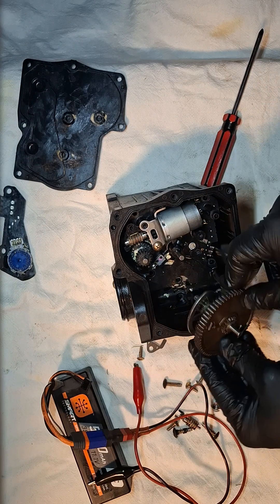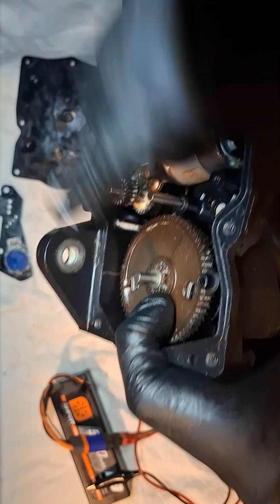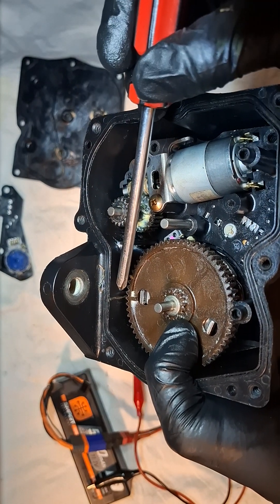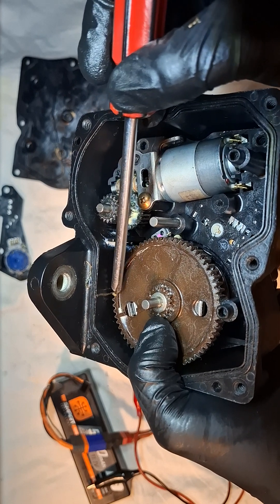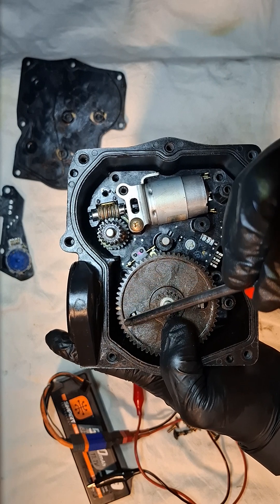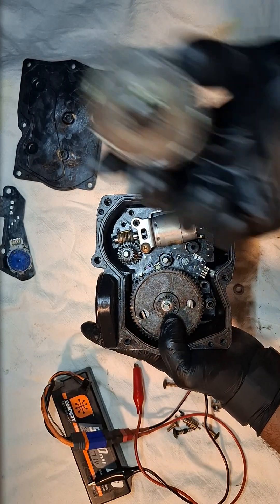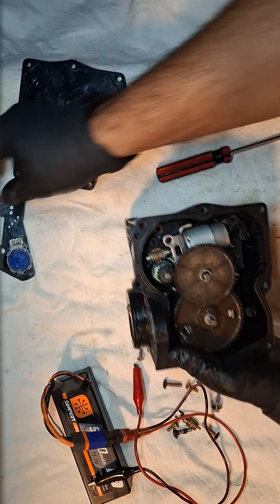What we are going to do is sit this one in the middle. Inside the case you're going to see a plastic line — I have highlighted it so you can see it on camera. You're going to sit it in a straight line and then rotate it four teeth: one, two, three, four. I have marked it here. The position will be: this one goes straight here, and then fourth gear — one, two, three, four — is this way. There is a sensor here that is just at the start of this gearing.